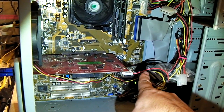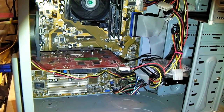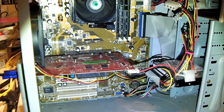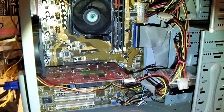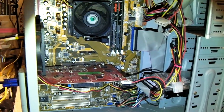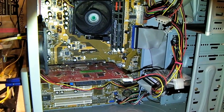It's funny, this graphics card actually has a supplemental power connector, and it uses a floppy disk drive cable. Now, from what I remember, I thought AGP cards that needed supplemental power used a Molex connection, but I could be wrong. It could just depend on the card. I looked up this card, and it's funny, they never mentioned the card needing supplemental power. I think this card only has a TDP of like 35 or 40 watts.